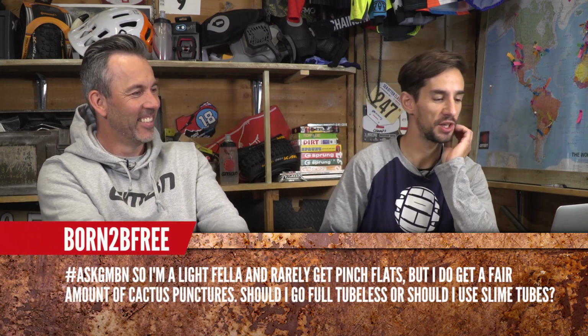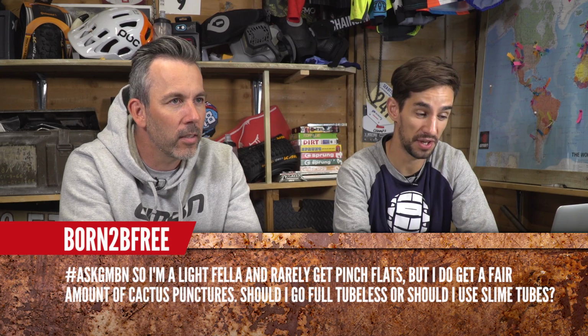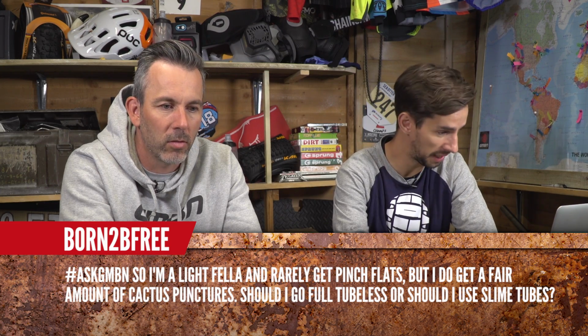Born to be free says, I'm a light fella and rarely get pinch flats, but I do get a fair amount of cactus punctures. Not from the UK, obviously. Should I go full tubeless or should I go to slime tubes? Oh, well, a bit of support there in the tube is good, but I don't know. Is it tubeless? Definitely. That's what it's designed for, really, to be honest, I think. So definitely go tubeless. And we've got a video on top 5 mistakes you'll make on going tubeless, so watch that and don't make any of them.